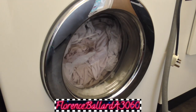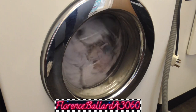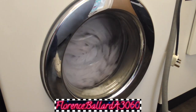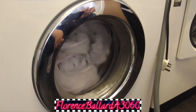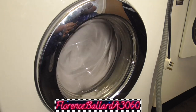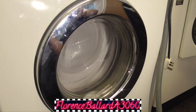This is going to do high-level rinses because the machine's configured for a full load. That's good because it cools everything down a bit. The machine's doing a very long distribution — quite unbalanced. It's like something was coming through. It seemed like a suds-lock sort of cut out a few minutes ago.